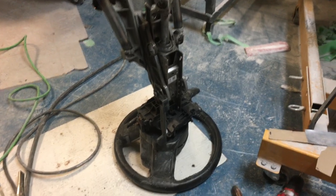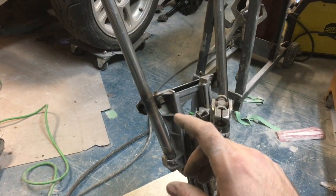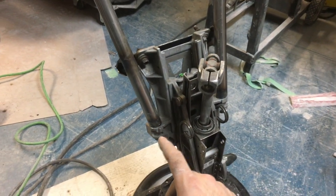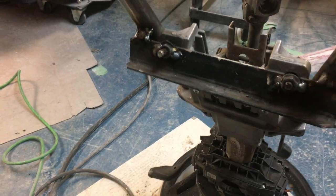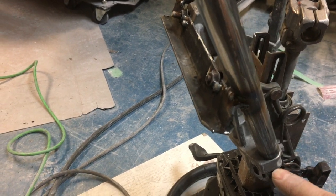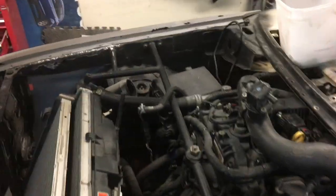Here's the 2015 Mustang steering column and steering wheel — it's telescopic and tilt. I've made a little bit of a design so we can mount this into the car. It bolts here and here on each side. The first thing I did was this angle bracket with weld nuts on there so that bolts in place. Then I've welded these pieces in this location, and it bolts there — so going into the car we can weld this in. These will be trimmed down yet.